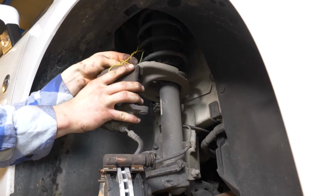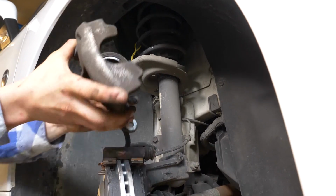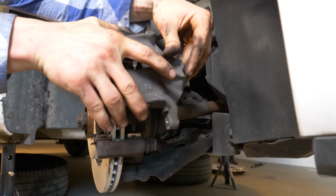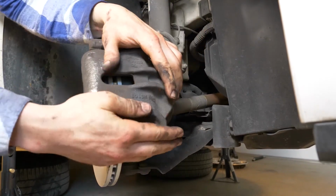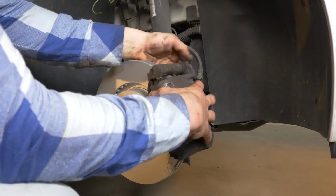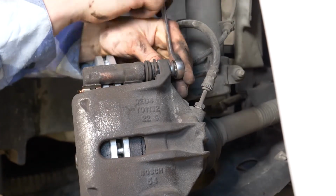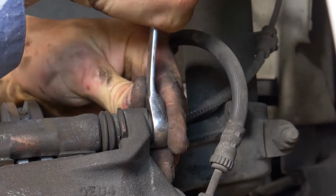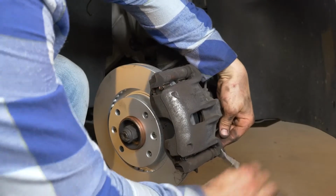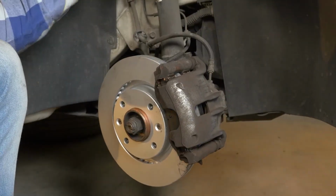You can now replace the caliper. Start by first screwing the upper caliper mounting bolt and, as always, start the process by hand and finish with a wrench to fully fix it in place. Don't forget to use the new screw provided, which has been pre-coated with thread locker, and screw the lower caliper mounting bolt back on. You can then repeat the same process on the other side.